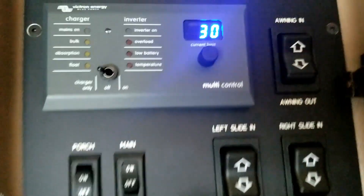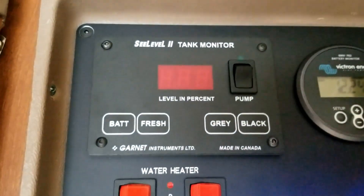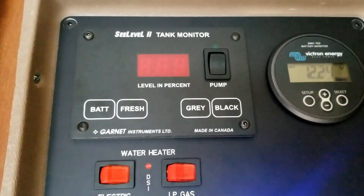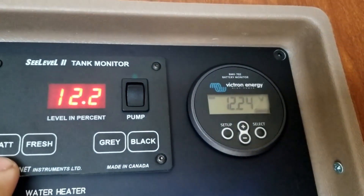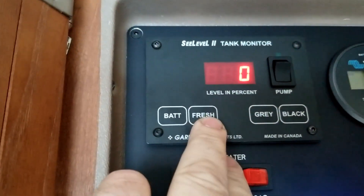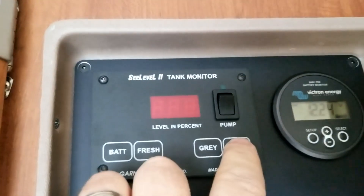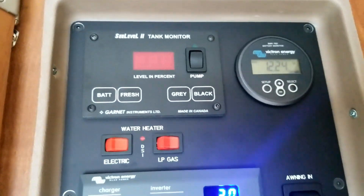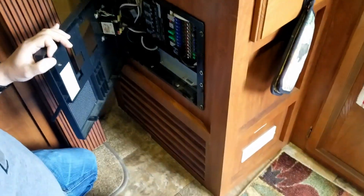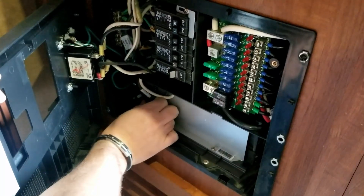We also got a control panel, which is optional — it's up here. This is pretty neat. We've got the battery monitor we had before we made this upgrade. This entire panel is something Chris put together and had custom made — engraved, changed all the switches to black, and labeled them better. So it says 'slide in' or 'slide out,' 'right slide,' 'left slide,' 'main lights' — you can turn on the outdoor light right there. We also put the SeeLevel tank monitors on while we were under the trailer, replacing the old probe-style ones. These SeeLevel ones just stick on and you can use the existing wiring, which is real nice. It's also got a built-in battery monitor. We're in storage so we don't have any water in the tanks, but it gives you a much better indication. The only problem was the black tank was a little hard to get accurate — we dumped and cleaned it before storage, but we keep a little fluid and antifreeze in it during winter, so it's reading about 13 percent.